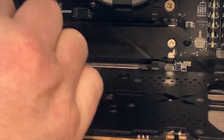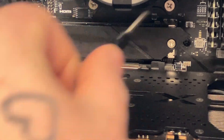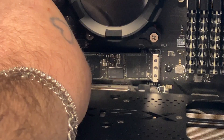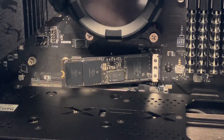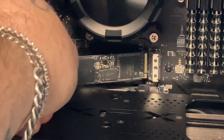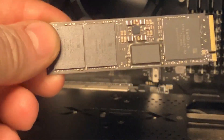If you don't have a factory heat sink you'll just have one retaining screw in the back of your drive holding it in, but if you have one you'll have to remove the two cover screws. Mine was not adhered very well. After that I'm going to pull out this mounting screw in the rear, then your drive will flip forward and you just slide it out. That easy.